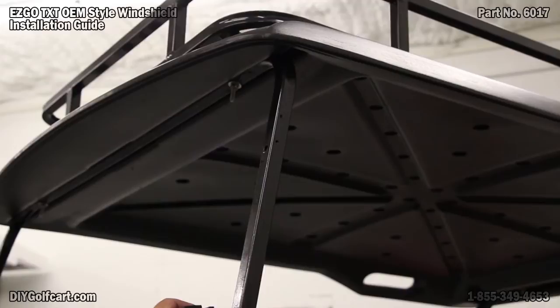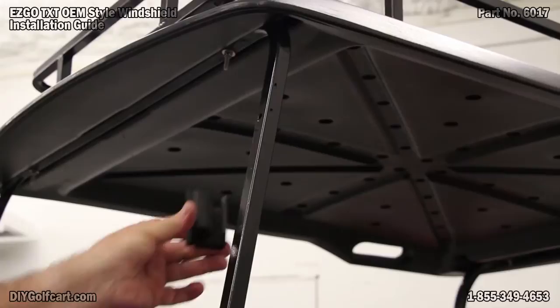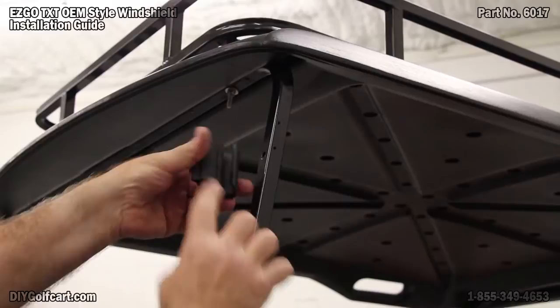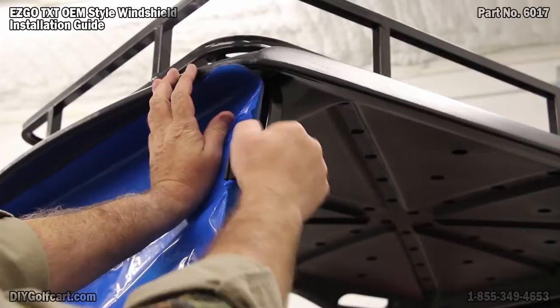Now that we've got the lower bracketry on and the windshield is secure, now we have the upper windshield brackets. You have a rubber opening — we want to put the rubber opening to the outside — and the plastic opening, we want to take it from the inside out. Now there's a pre-drilled hole already in the frame, so what we're going to do is actually put this over that hole. We've got the hard piece here — we'll go from the inside out and just clamp it on like that. That way when we raise the windshield, we can pull this rubber piece out, and that securely holds the windshield.